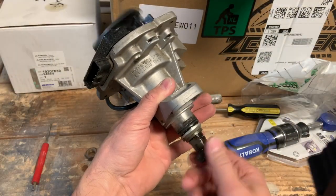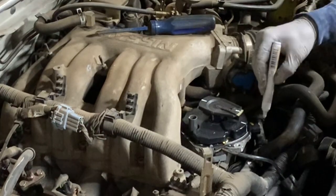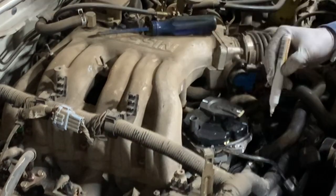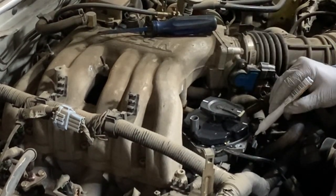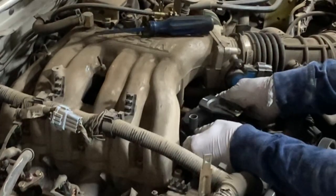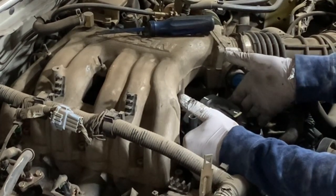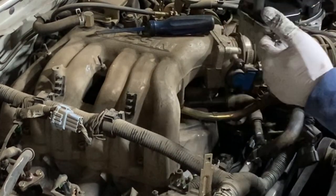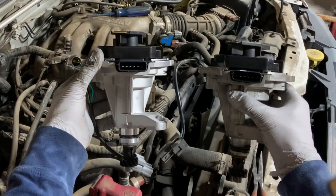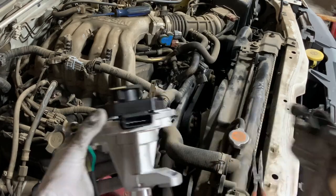Once the new distributor cap was off and everything looked the same, I timed the rotor so it was in the exact same position as the old rotor before I pulled it out of the engine. All you have to do is rotate the gear at the bottom of the distributor. I also added one more timing mark — I marked where the pigtail was going into the distributor on the little tube right underneath it to give me one extra reference point. Then I pulled up on the distributor and pulled it out of the engine. If the top of the engine is really dirty, take a blow gun or brake cleaner and wash off where the distributor goes in so you don't dump debris into the engine. Then I put the distributors right next to each other — upside down and backwards — to make sure they are identical before placing the new one in.